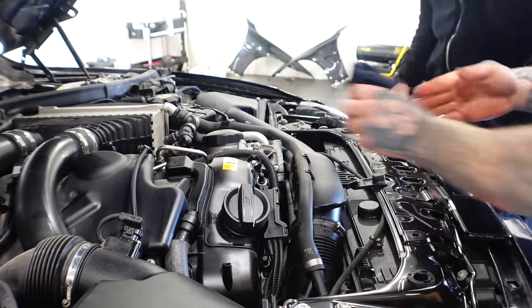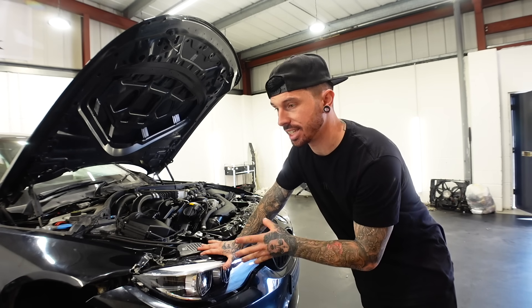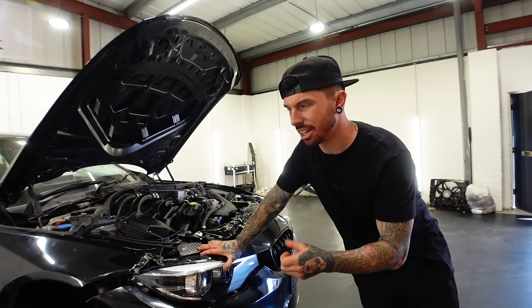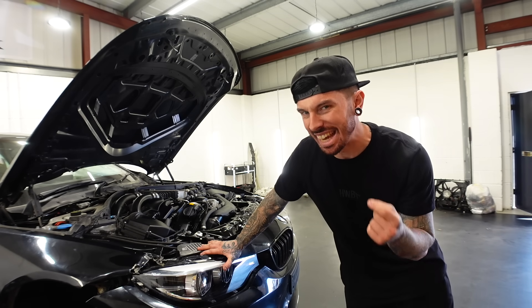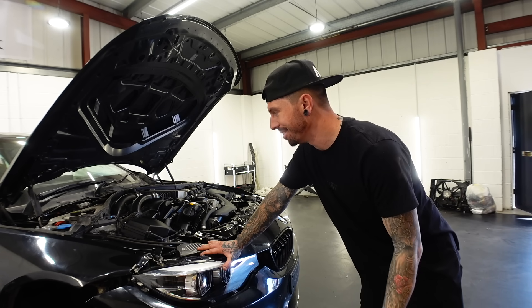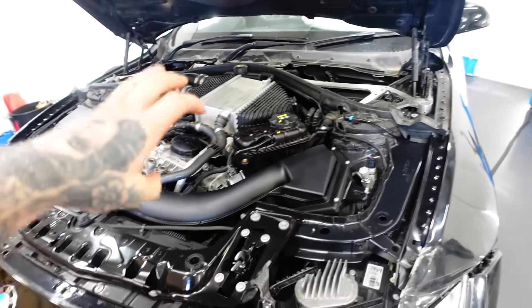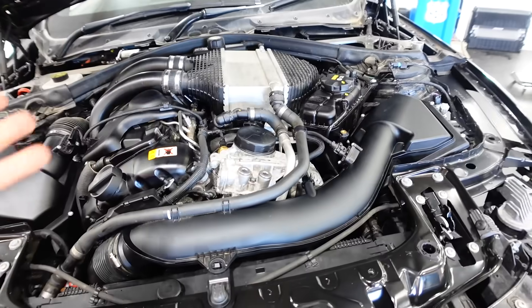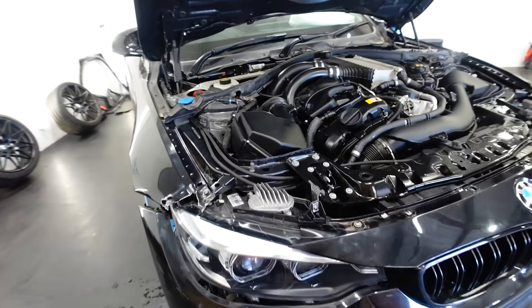For now let's move on to the engine — change the old oil filter to a fresh new one, then put some budget 5W-30 fully synthetic in. I'm using this oil just because I want to run the engine through then drain it out afterwards to flush out any old rubbish before putting some good oil in. There's engine oil in and there's gearbox oil in. Also just before we start it, there's no coolant in there at the minute — on these engines you can't just pour it in, it has to be vacuum-filled somehow. But I've got the kit, we're not going to run it to temperature anyway. I just want to see if it runs.